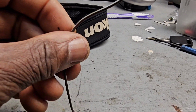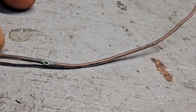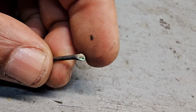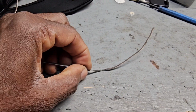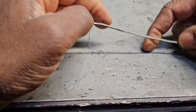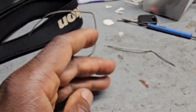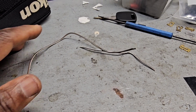Check, we are talking about the gray wire that's coming from pin 3 and connector 3, pin 3. There is no continuity between the relay and the engine computer. Automatic shutdown relay. You see here? This is the wire. Okay, pull this one now. Spaghetti. Pull it, hold it. Yes. Uh-oh. So this is what happened to it. The computer sent ground, but it never reached the relay. That's why the code P0688, automatic shutdown relay circuit bad.